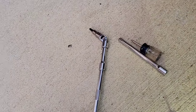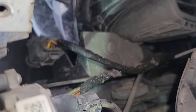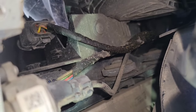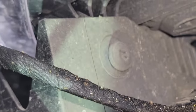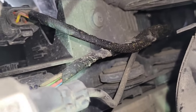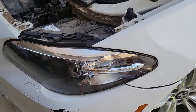You're going to need a T30 with an extension and a pivoting head. Go in here and at the very top right there — right where my fingers are — there's a T30. We're going to remove that and hopefully it comes loose.